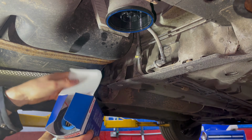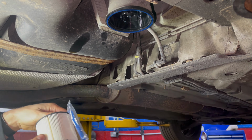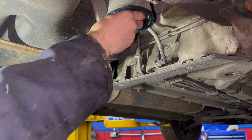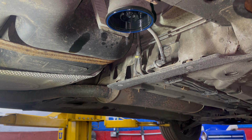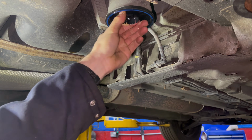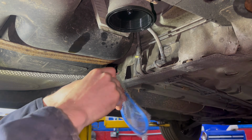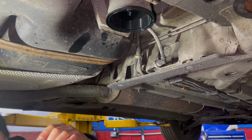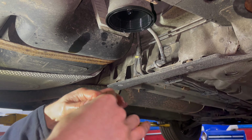This is the new filter. This side's the top, and to the bottom, as you can see, the old filter as well is still there. So we just need to pull the old filter out of position. It's pretty well stuck. Replace the old filter housing seal, or O-ring. When fitting the new seal, make sure that you coat it in some grease.